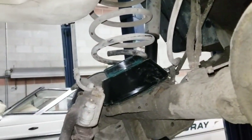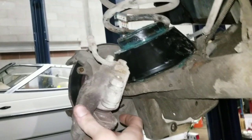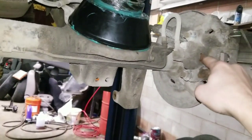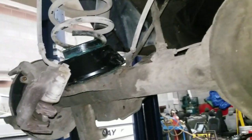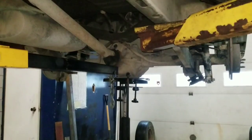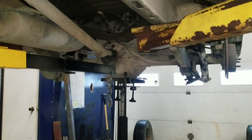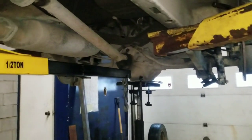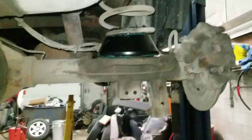And on the other side, this brake caliper must come off because she's got some dangle to her, where the other one is on the axle, as pointed out. Other than that, slide in your spacers and reinstall. It's really quite simple. Just so you people understand the dickery that sometimes goes into these repairs, you know, gotta remember, safety third.